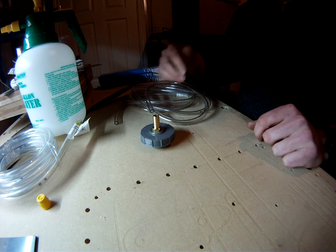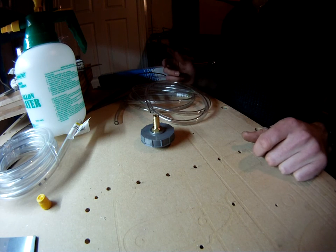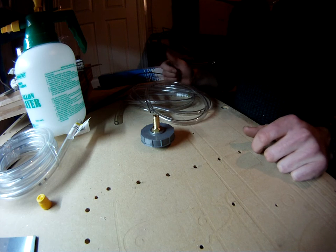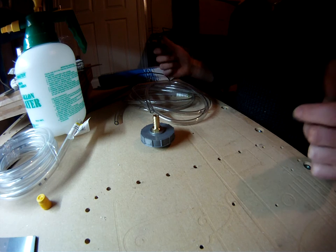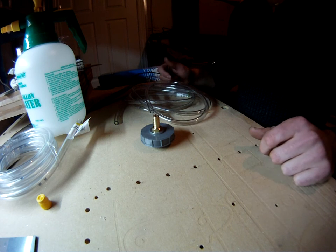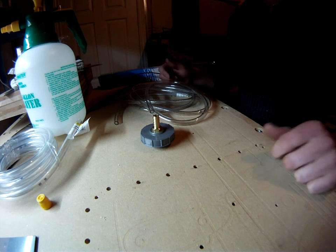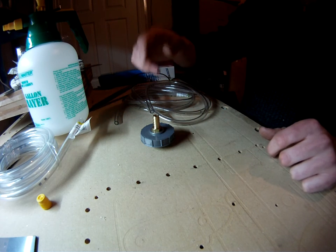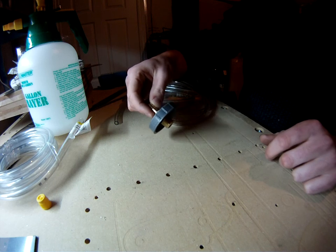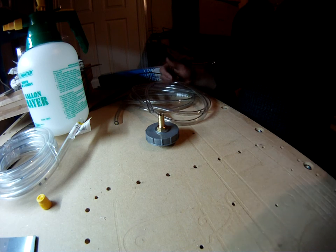Empty and purge the fluid into a glass jar or something. It should push air out of the system, then close your bleeder valve on the slave cylinder and you'll have a bled clutch system. You can do this on your brakes, your clutch, or whatever hydraulic system you want. It's a handy tool for under $25 and a lot easier than buying one for $150. All the part numbers and descriptions for the fittings will be in the video description below. Thanks for watching.